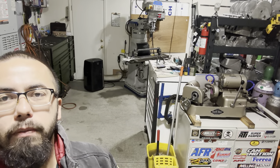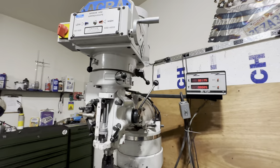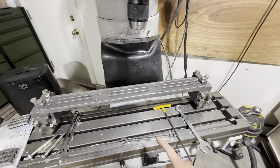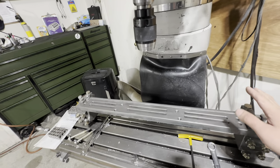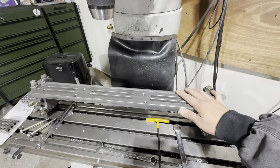Most of the time you'll see somebody do a screw-in stud conversion in a seat and guide machine, which I don't own anymore. I've had a couple of them and they're really great to have, except once upon a time I sold everything and just bought that one machine. Considering I'm just a hobby machinist these days — cue the comments — this is working out just fine for me. I'm already set up to do the 7/16 stud conversion. Big block Chevys have a canted valve angle of about four degrees. We're going to bolt the Raylar head directly to this fixture, sold by CP Motorworks in Janesville, Wisconsin — a good friend of mine. This is easily the most useful tool you can have for doing automotive machine work. If you want to add some more capability to your setup, this is easily the best money you can ever spend.